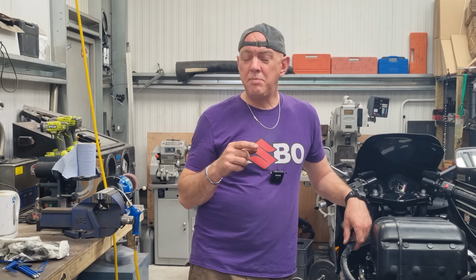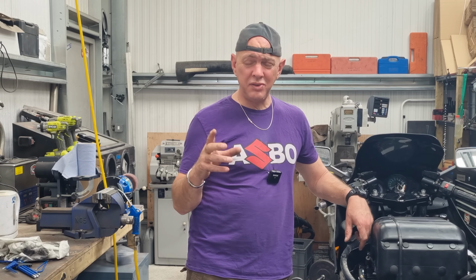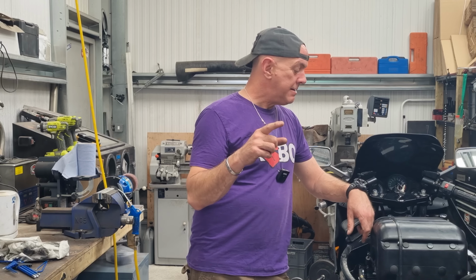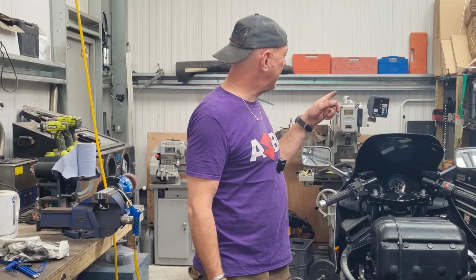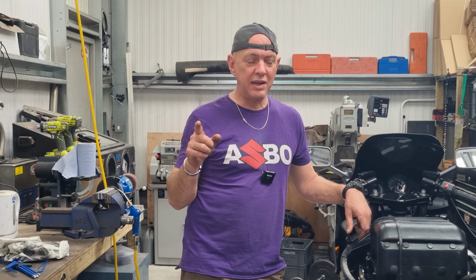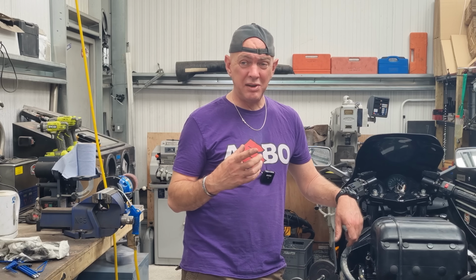When the bike was all done, the tank was rusty inside, but it was all cleaned out, dunked in citric acid, and then washed out. It is conceivable that there is still a little bit of goo sitting in the bottom somewhere, and it's dragged some flakes of rust through. I doubt it, because if you look at the fuel that I've shoved in the little auxiliary tank, there's no bits in it, so I don't think it's the tank. It could be that something did get dragged through and it's blocking up a pilot jet or something like that.